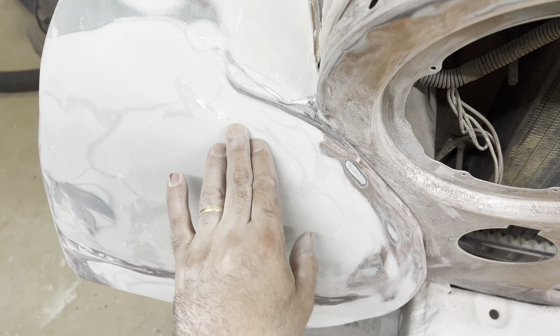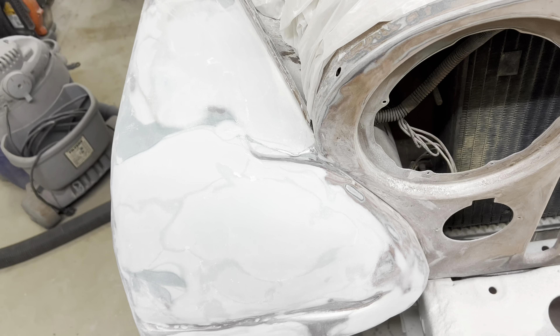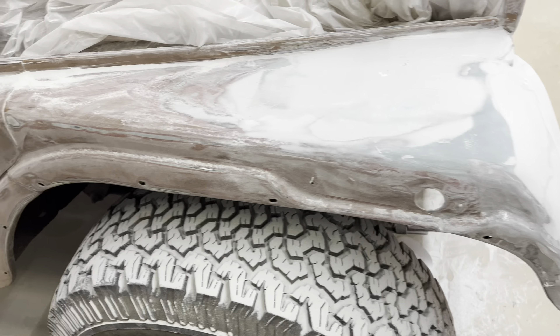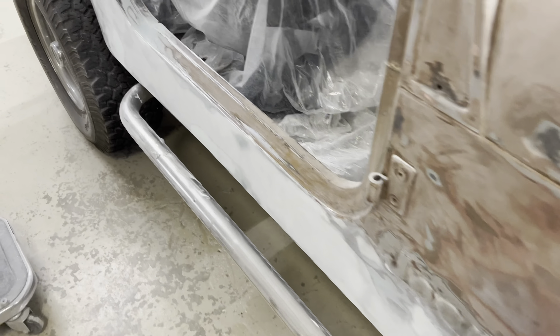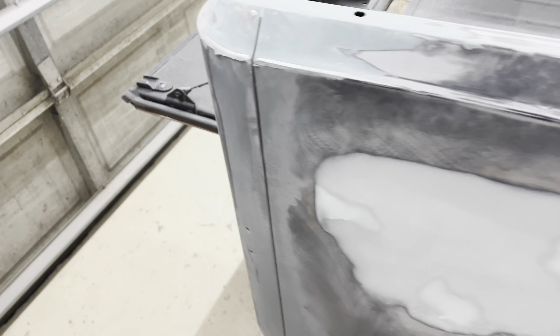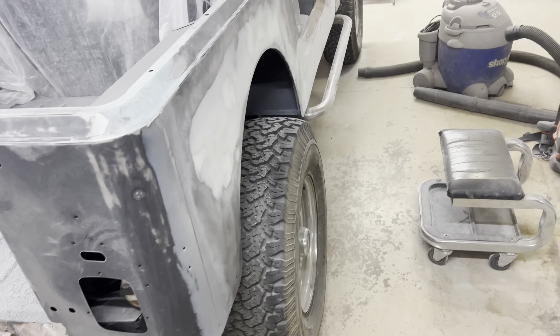Again, won't know for sure — there are some areas that are going to need to be glazed. Won't know for sure until I get the primer on it. So at this point I'm going to take a break, and then I'm going to come back out and sand it again with 220, and then wipe it down.